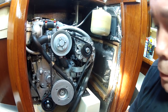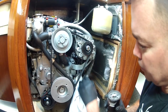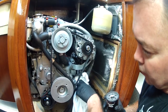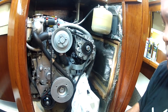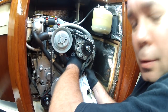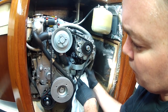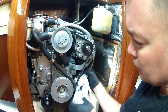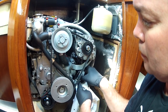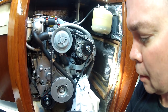Changing the filter - you want to do this before you put oil in, or it's just going to leak out all over the place. The trick here is go ahead and get a rag ready, put it under there because it's going to drip a little bit of oil. You just don't want it going down into your bilge. It's not the easiest thing to access but it's usually hand tight. A little bit is going to leak out - more than you think - so get it out of there quick. It probably leaked maybe a tablespoon or two.